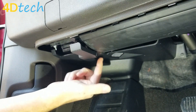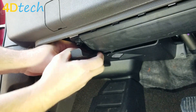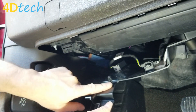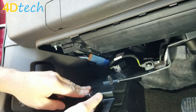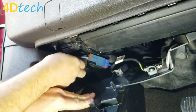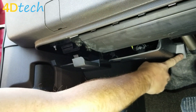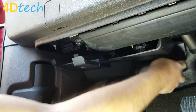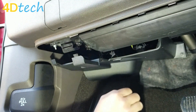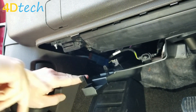There's a single push pin right here above my finger, and the easiest thing to do is to slip your hands above the panel here and press down to get that clip out of the way. Once we have that clip out of the way, you can hold the panel pressed down. If you do end up needing more room for your hands, there's a single 7mm screw right here up at the firewall, and then two more clips at the other end of that panel that wraps around, and then the whole thing will drop down in the pedals. That's unnecessary if you can get your hands in here — only if you're having a hard time accessing.